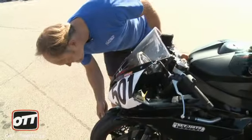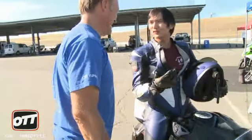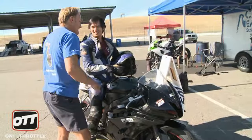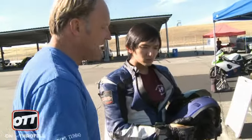Tire wear on the back is great — that's cleaning up nicely from the previous time it was ridden. On the front, I didn't really lean too much. No, and that's what the rest of the day is for — there's no rush. I didn't want to have happen what I did last time here. Now that you've got a good feel for the bike, make sure you're accelerating hard when you're straight up and down, and braking appropriately straight up and down, to get a good feel for the way the bike handles. Bring it back so I can see how much travel you're using in the front. For brakes, it's really important that you use the same marker — find a big patch on the track or where the road comes in before the bridge and just brake there all the time. If you find you're braking way too early, adjust and start picking up reference points for braking only.